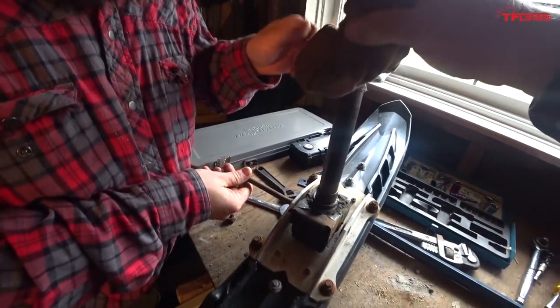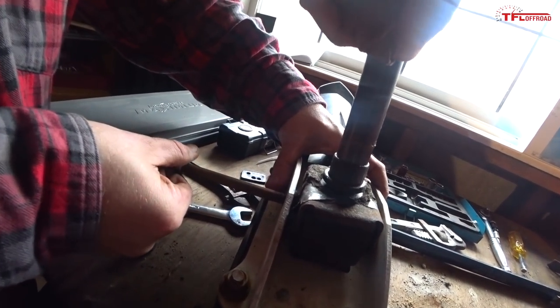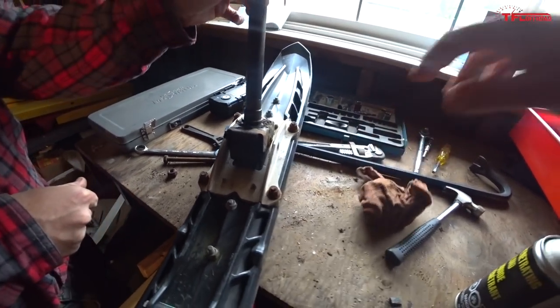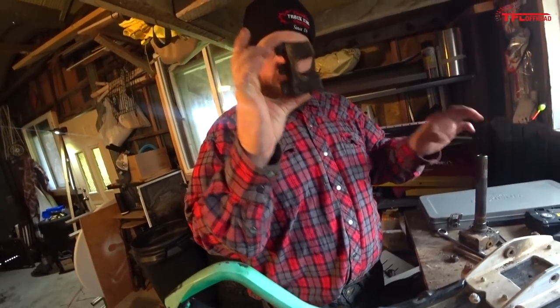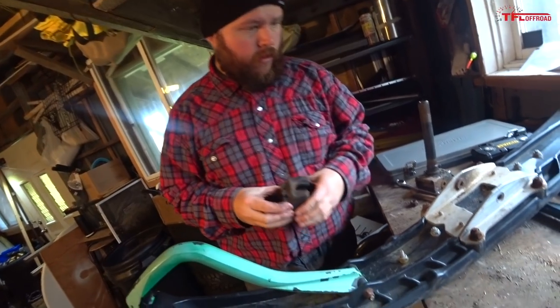So here, if I push down on the gasket. No, it's too much. It's got no give to it. Yeah. It's a solid piece, right? No, I know. That's fine. We're just going to shave a couple mil off the bottom of those feet. We'll just take off like maybe 2 mil on each one, and then we'll try it again. Okay.